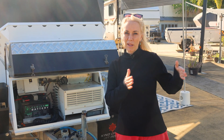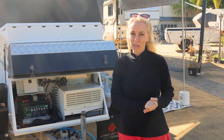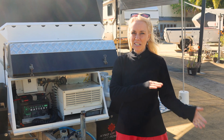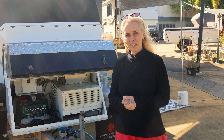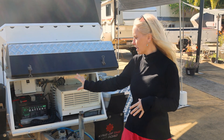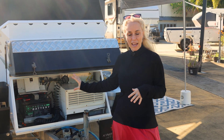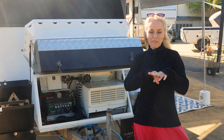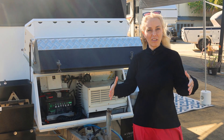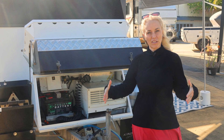So long as these standards applied to the standard of the time, you're okay. But if you're upgrading from AGM to lithium, or you're upgrading your battery system, you might hit some problems with the standards, which means the lithium battery has to be either in an outside box that is dustproof, or you'll have to create a fully enclosed box in your habitable area.